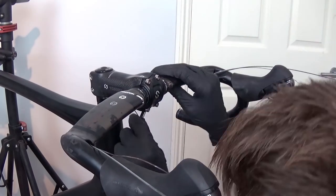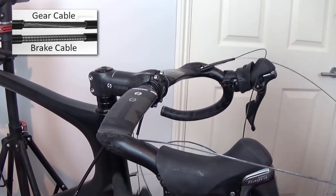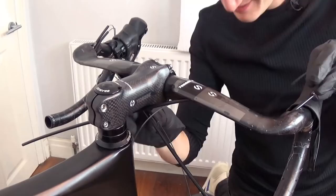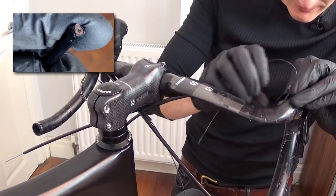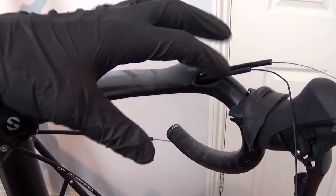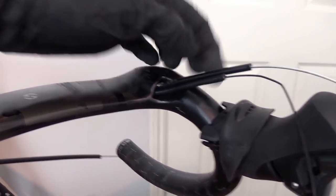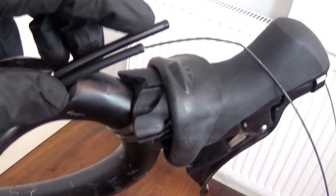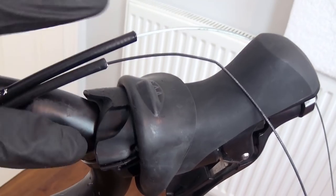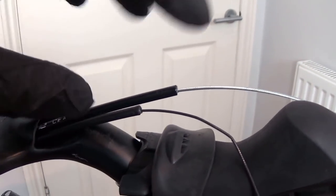So when fitting the cable outers, there are a few quick things to note. The first is that the brake and gear cable outers are constructed differently — brake cable outers are around five millimeters wide, whereas the outers for the gears are around four millimeters. In addition, new cable outers fresh out of the bag can have rusty ends as the cores are usually made of steel, so you're going to want to snip those off before you size your outers and install them. The brake cable outer and gear cable outer pop out of their respective places in the bottom here. Next, I need to seat these cable outers into their proper places in the shifter — the brake one goes in this hole and the gear cable outer goes in there. Before I do that, I'll put a little bit of grease on the ends here, because the ends are just raw steel, so a bit of grease before you insert them will stop rust and maintain a bit of longevity.